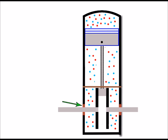These are the main seals, and they keep in the pressure, if you like, inside the crankcase. So we've got the crankshaft sticking out there, both sides, but the main seals here keep the pressure inside. And of course they do so whilst allowing the crankshaft to turn the flywheel. There is only one crank seal on each side of the crankcase, by the way.